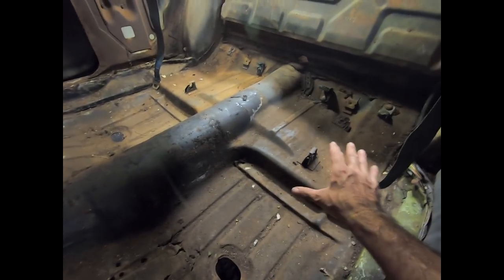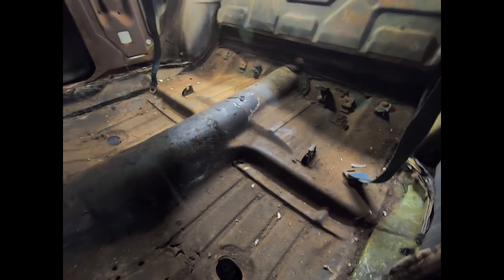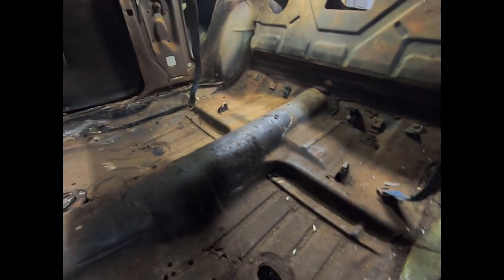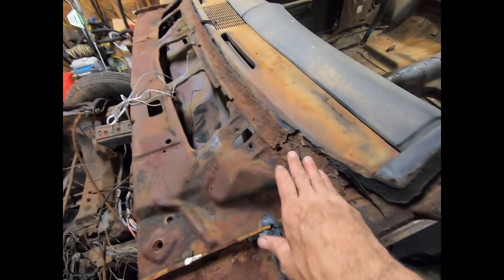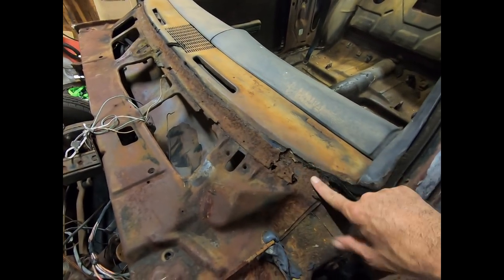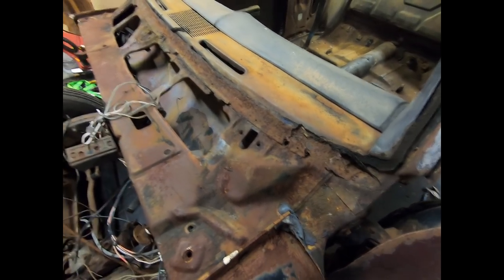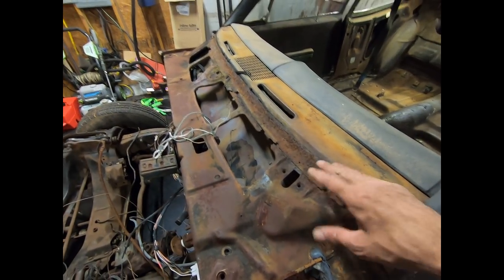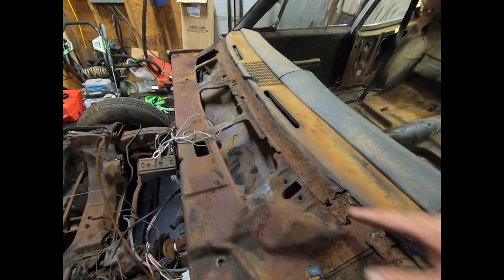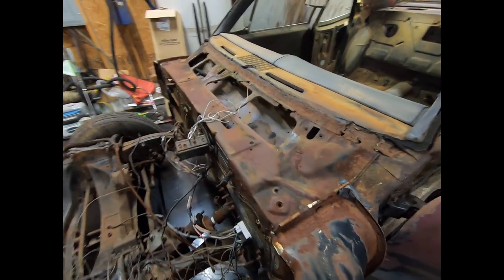Good thing is the rear seat well is in pretty good shape — I don't really see any issues at all with that. Hopefully I can get the bolts out of the seat belts for the back. The inner rockers and stuff all look good, not too bad. The dash is going to need some work. Not sure if I can just put a patch panel on each side; the other side gets into the upper cowl area underneath it. Ideally I would try to patch and clean this up, and hopefully there's no breakthrough so I can get the rust out, treat it, and put something under it so the windshield will seal.